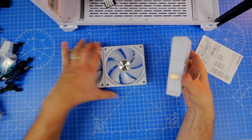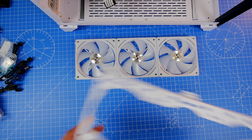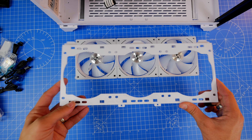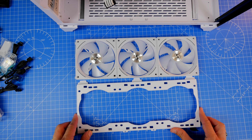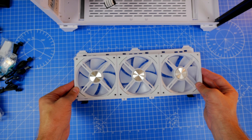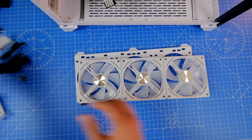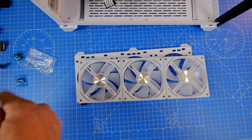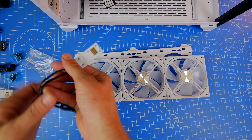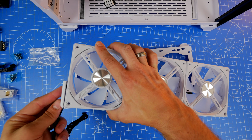I'm clicking three fans together and mounting them to the bottom fan tray in my Dynamic XL case. You need to think about the direction the cables are going to face because you can only connect the connector to one side due to how it sets up. The fans also click together in one direction and the connector only clips on in that same direction, so make sure it's going to be the right way around.